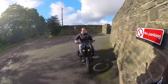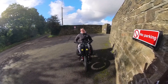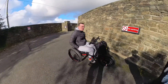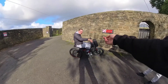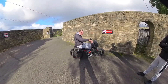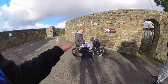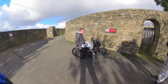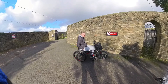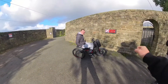So you can see when I let go - it's smooth, really smooth. It's consistent. You can judge it. But the other brake fills back up - that's called regen, I've put it on a tiny bit. When you come off the throttle, it's called engine braking - it pulls the power from the motor and pushes it back into your battery. It gives battery life, but it does drag your drive. If you don't do that, the energy you've given it just gets lost - you throttle it, it drops past it and you've lost it.